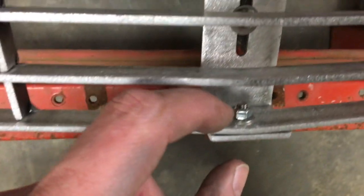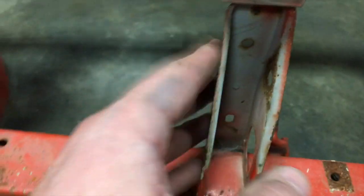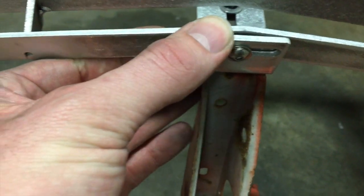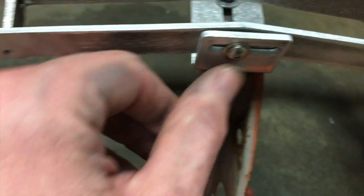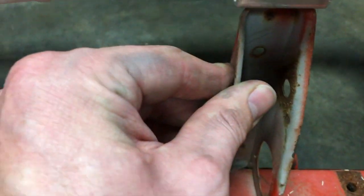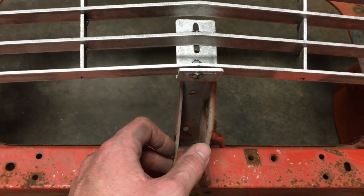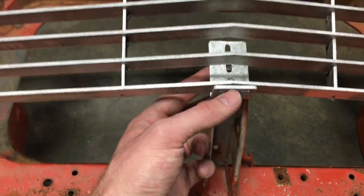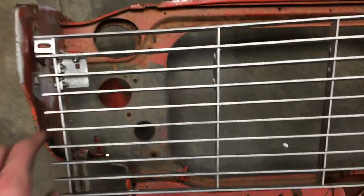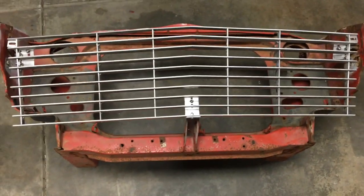On this bracket, the reason why we slotted it was because most of the brackets I've been able to test fit have been tweaked or bent somewhat — it seems like a pretty common occurrence. So we put this slot across here in case yours is a little tweaked too. You can see on this one it's not perfectly centered because this one has a little tweak to it, as well as the other cars we tested this on. Once you get that adjusted, you're going to want to tighten down the hardware — tighten down the three mounting points — and you'll be all set.